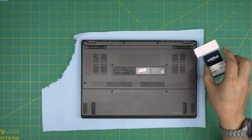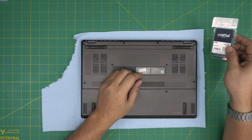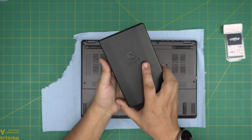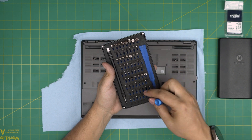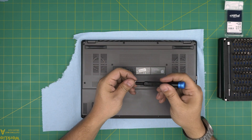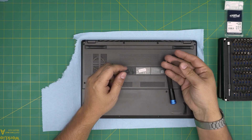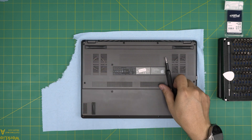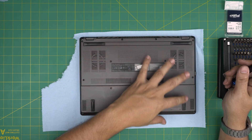All you need is compatible RAM — this is a Crucial 16GB 3200 DDR4 — and a screwdriver set. I'll use the iFixit screwdriver set, as they're one of the best out there. We're going to use a Phillips number zero. If you get the pro set, it includes opening tools and tweezers. If not, grab yourself a spudger — metallic spudgers are really suitable for opening cases and covers.